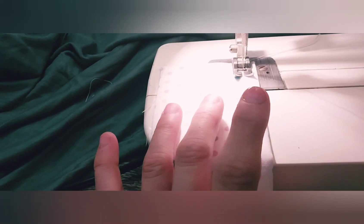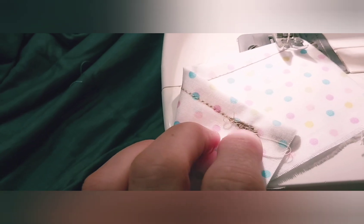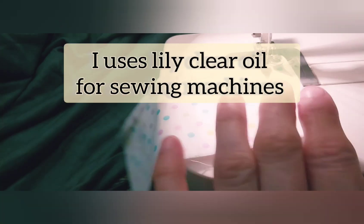Let me let you hear this, and then we'll go over the rewind. It's a little rough because it hasn't been sewing for a long time and it has a lot of oil, so don't send anything through just yet because it takes a while for the oil to work itself out. You can see there's lots of oil in it, so if I were you I'd run it a few times before putting it on any clothes. The oil in there - somebody used car oil or bicycle oil and it comes out black. My oil is more of a white clear color.